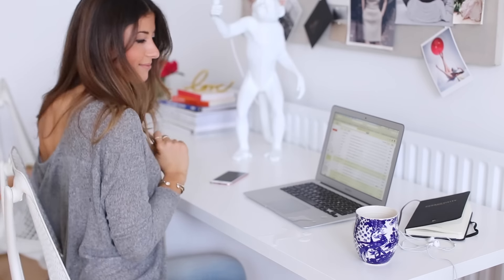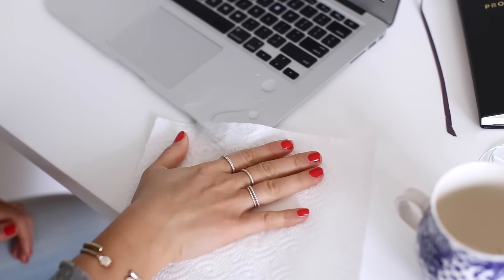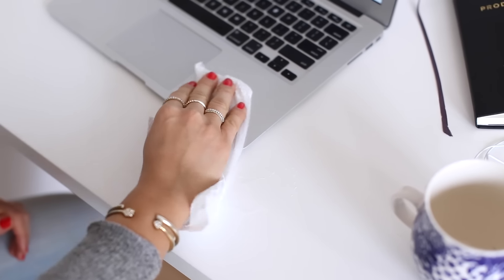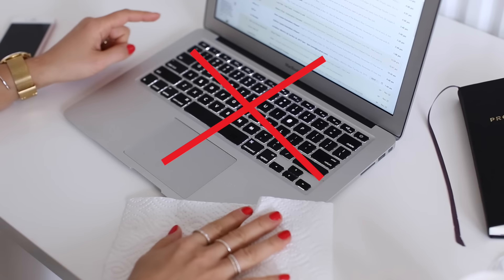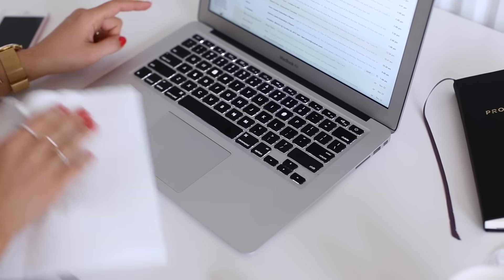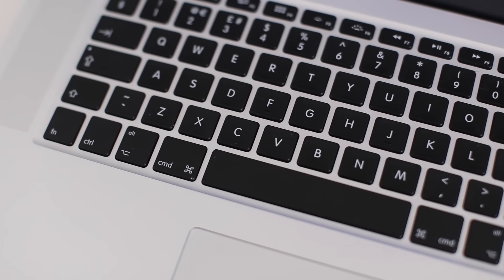First, I'm going to pick up the cup and put it away. I'm going to grab some paper towels and wipe the area around the laptop to make sure more water isn't going to go in. I'll wipe the table and around the keyboard. However, I'm not going to touch the keyboard — do not touch the keyboard at this point. When water goes into the keyboard and comes in contact with electricity, that's what causes water damage. It's not the water per se, but water coming in contact with electricity.